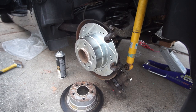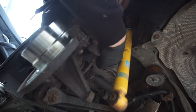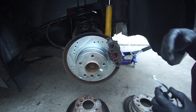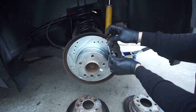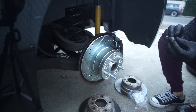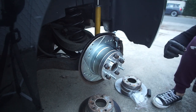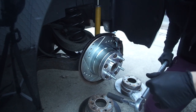The rotors are cleaned — it's time to put everything back in and reverse the process. To finish the product, I'm gonna add back our safety pin that we were missing, and everything should be it. And of course, do not ever forget to torque your bolts back to spec. In my case I'm gonna do 75 foot-pound torque.